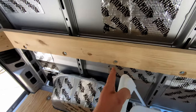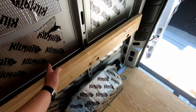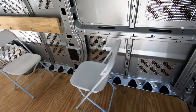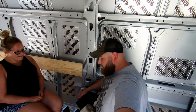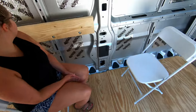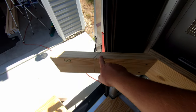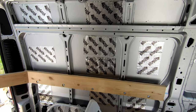We're going to have that bulkhead here that separates our electrical, fresh water, water system, pump — everything. That'll be about 43 inches from the back. I'm just trying to drive the back of the chair. We have like 24 inches in the chair and I think this can even cheat back a little more. That helps me determine the bulkhead placement. So that is the king bed — to get all the headroom, I'm going to run this headboard on a 45, and that'll prep to trim all this out and finish it really nicely. Next step is to build this bulkhead.